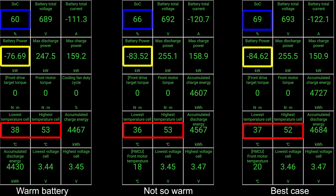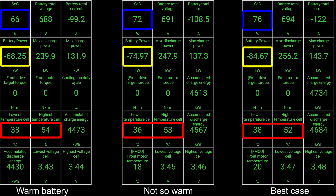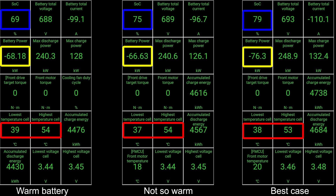But it doesn't make sense because if all three cases ended up with the same hot battery - you see now 53, 53 and then 52. The last case - how could they maintain 52 degrees? I think it's because the ambient temperature was lower. This could be a weakness of the BYD blade battery. I heard that the Achilles heel of the blade battery is that the core, the center of the battery cannot be cooled enough. This is the Tang with 111 kilowatt hours. Previously it was 86 kilowatt hours - they bumped it up by a lot, and I suspect they packed the battery tighter, and then it rapid gates worse. It's like the 30-kWh Leaf versus the 40-kWh Leaf - the 40-kWh Leaf was the worst when it comes to rapid gating because it maintained more heat.